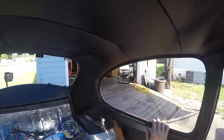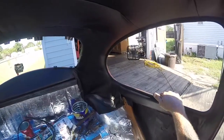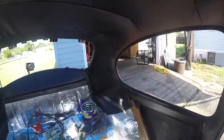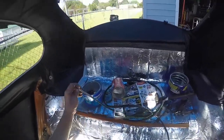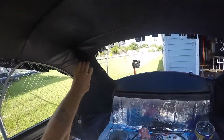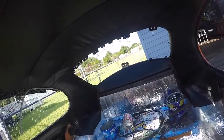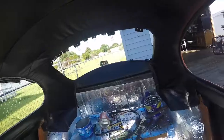Putting the pop-outs in is my first time — there are plenty of videos out there to watch. Basically I watched them and made sure I knew where the seal was going to be cut. They say about a quarter inch — no more than a half inch — from the last screw hole. That gives enough for the other side too. I'm going to save these old pieces because they come in handy for the headliner. A lot of the wrinkles are going to straighten out — and the windshield seals just arrived. I only use quality ones; buy cheap ones and you'll wish you hadn't.